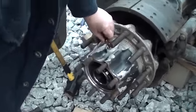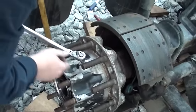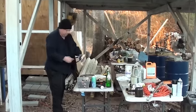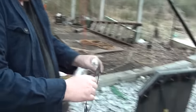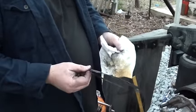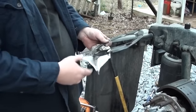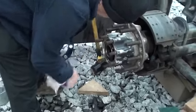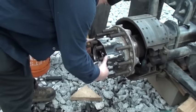I'm going to take this plug out — it looks like it's a quarter inch. Yeah, quarter inch. Let's get this plug out of here. It wasn't even that tight. I'm going to need to clean this thing up. Fortunately I have a ProStar — ProStars have these metal axle seals, and if it's in good shape you can reuse it; they're actually made to be reusable. Let's see if this one is. We're going to clean it up and then put the axle back in next.